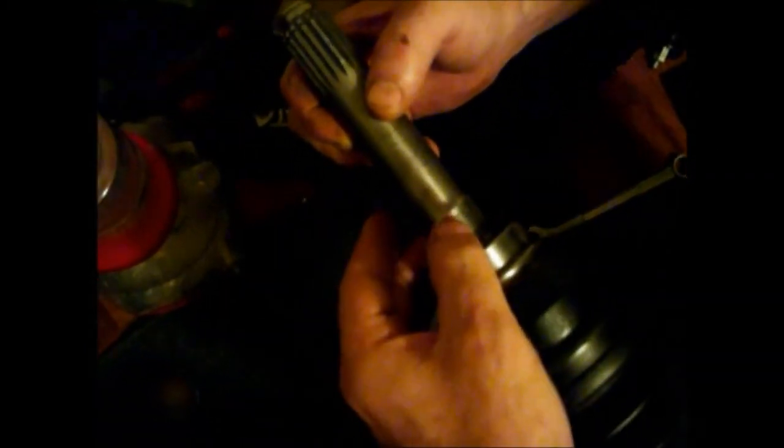These inner needle bearings are so hard to find that I had to get the numbers crossed so many times they had to be ordered from Germany. There are needle bearings pressed inside of the steering knuckle, which would often be overlooked. I'll show you — these are the old ones inside the steering knuckle.